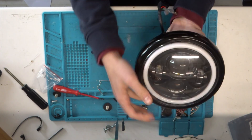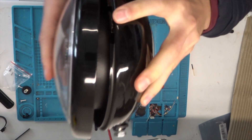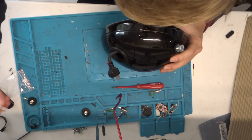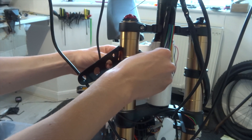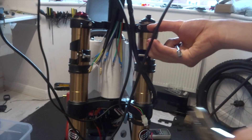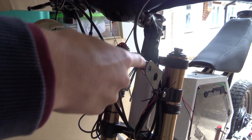Make sure it's all still lined up — it has actually rotated a bit. Then you can get the housing and feed the wires out the back. There's a little lip around the back which hooks under the same ridge as the clips, so you have to get that on first, line up the holes at the front, and then you have these screws which go in there. It doesn't have to be super tight. Because of how wide this is, I'm going to have to angle it in a bit, using a bit of cardboard so I don't dent it.